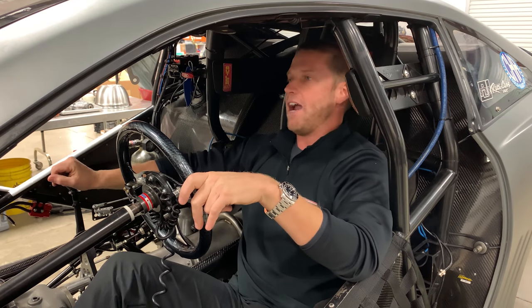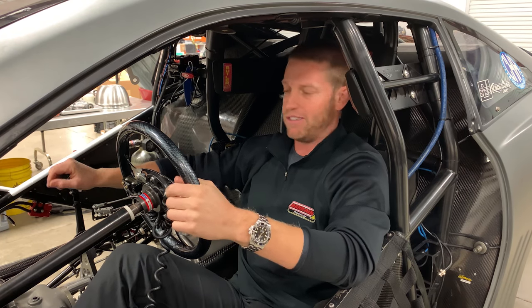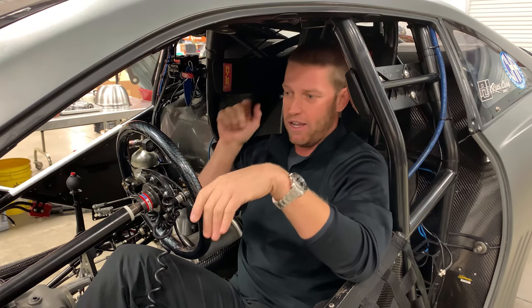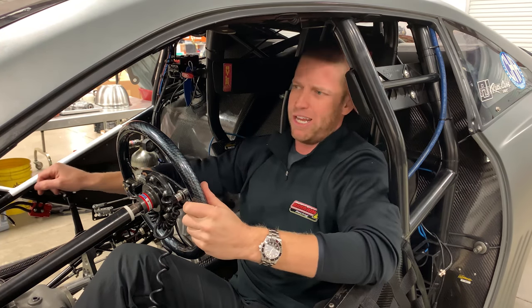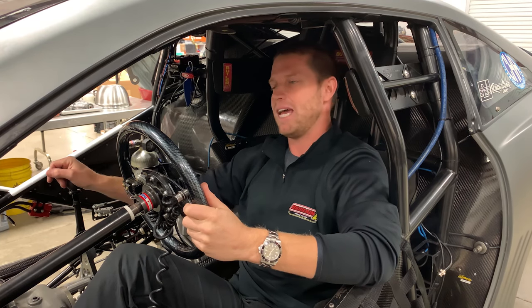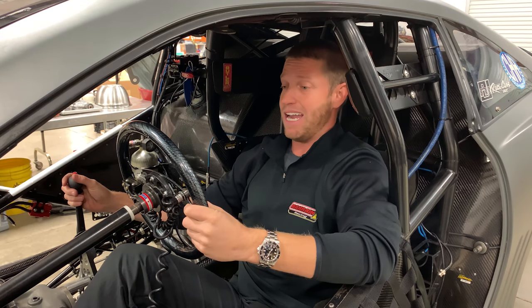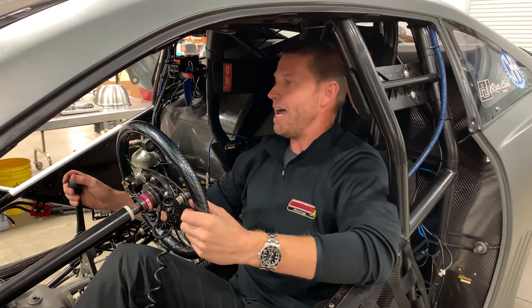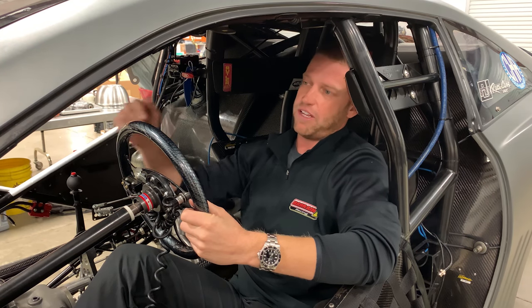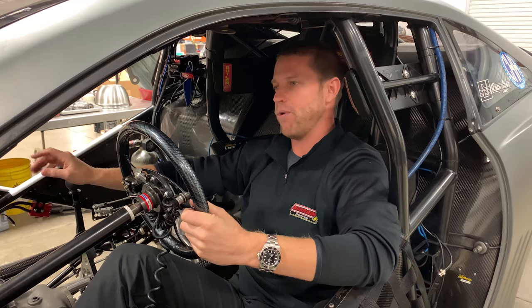Pretty much the thing's sitting there idling, and I'm staring at the head temperature. Right now, when I'm up there, that's the most important number. As long as it's got oil pressure, I know the motor's running, I want that head temperature a certain number. These things are very finicky on cylinder head temperature. You get them hot, it pisses them off. You get them cold, it makes them lazy. I know what tune-up Billy has in it. I know what we're trying to run, and I'm aiming for a number. Generally, I have structured my burnout and everything and how long it's run kind of by that anyway. So I kind of know where I'm at. Engine's heating up a degree every eight to 10 seconds at that point. It's not really heating up rapid.